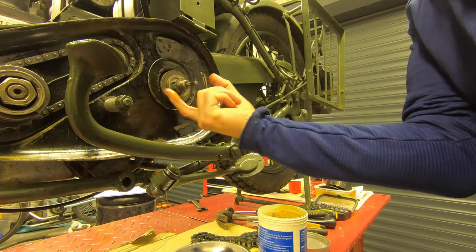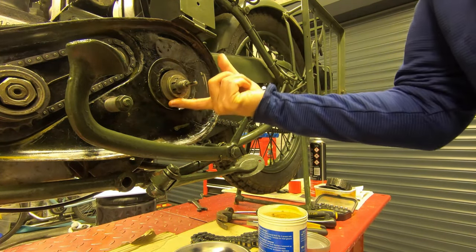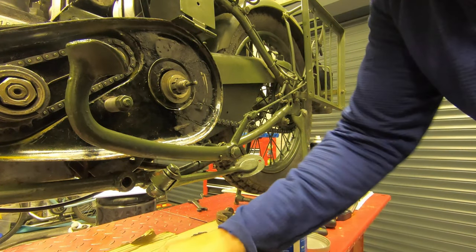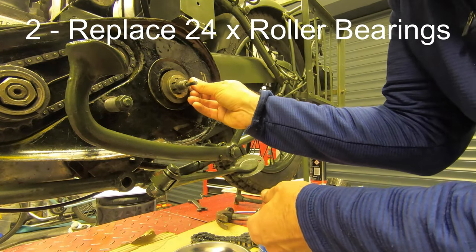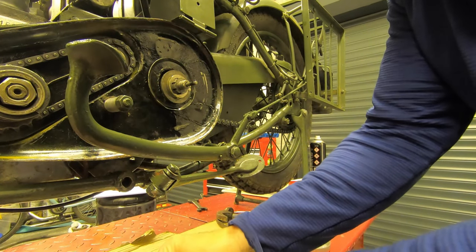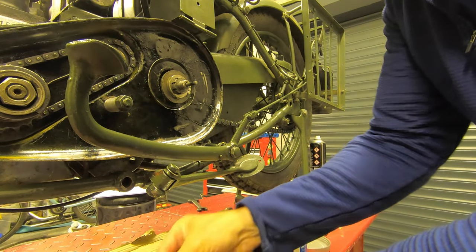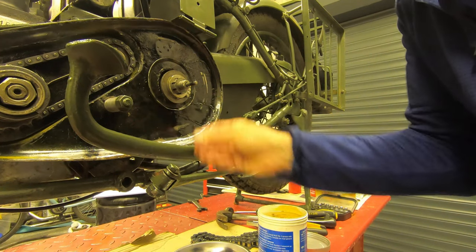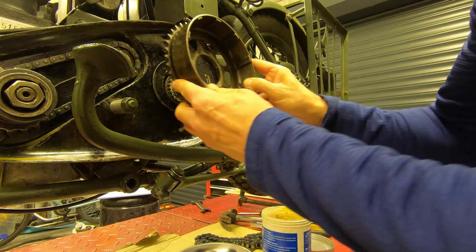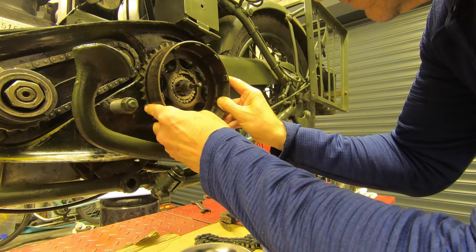Because the next thing we're going to do is put the roller bearings on, you just apply a little bit of grease and this will help them to stick. When you put the roller bearings on they're magnetic and they'll actually hold themselves onto the metal there — and if they appear to push away, remember they've got a north-south pole so just turn them around and put them on the other way and it'll be fine. It looks physically impossible but if you're careful you'll easily be able to build up all 24 roller bearings in a nice neat circle. Once you've done that, with great care put the clutch basket over the whole arrangement — when that's neatly in place a washer goes over that to stop the roller bearings falling out.